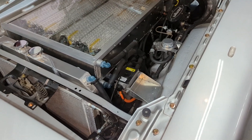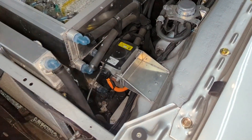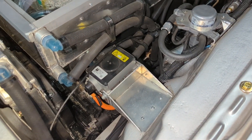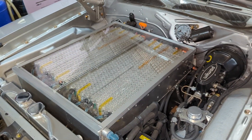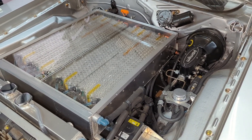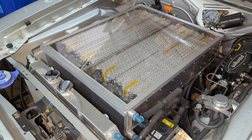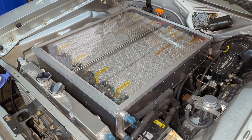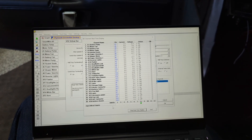In race mode — in addition to chilling the motor in the future — it can currently heat the battery. I use the same heater I would use in cold temperatures to take the batteries all the way up to 50°C, just like Tesla does in their race mode. What that does is reduce the internal resistance of the cells, allowing more voltage to flow straight to the motor.